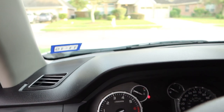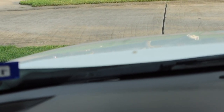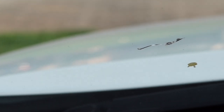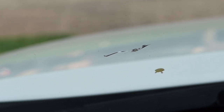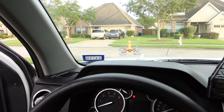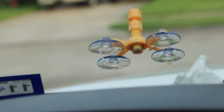I'm out here with my Toyota Tundra. I actually paid to have this one fixed and it didn't come out very well. The initial crack is right there where the hole is and it still has this line. The guy told me the windshield was hot and he couldn't get the glue to go down that crack. So I'm going to take this kit and try to fill that crack because it shines right in my face when I drive. I drilled it out a little bit and now it's pushing glue into that crack — we'll see how this one turns out.